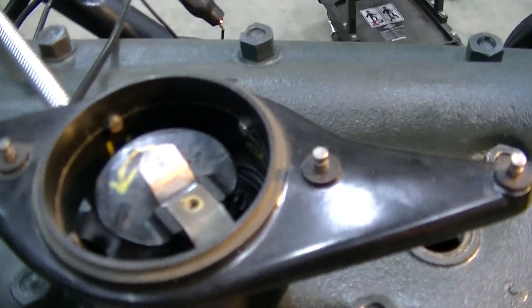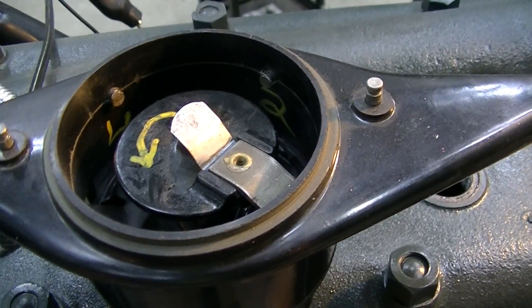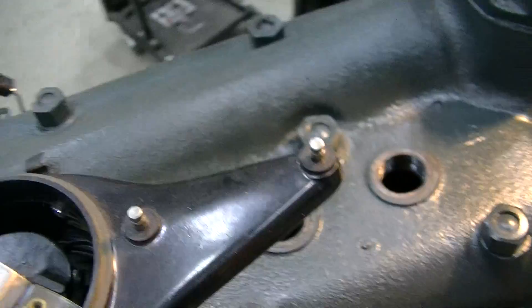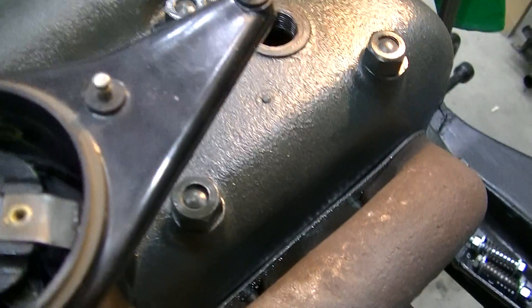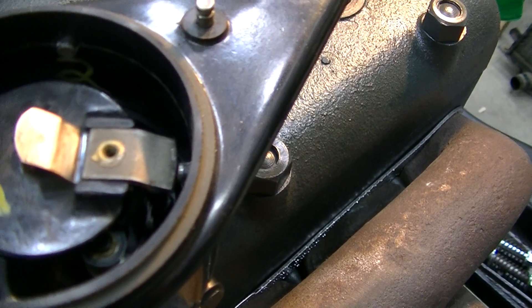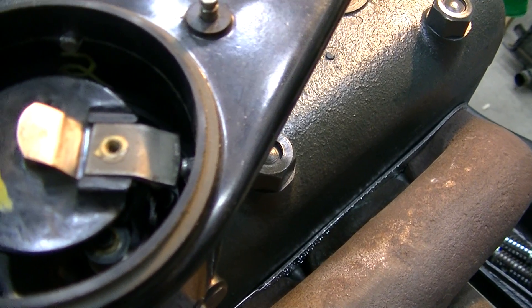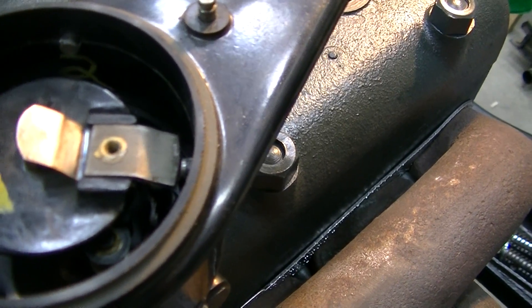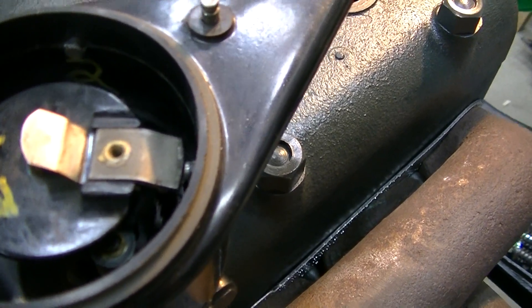For my own simplicity, I've marked the rotor in the direction that it rotates. There's a little gap between the rotor and that pin for number one cylinder — that's fairly important and it is adjustable; you can bend that tab to get that clearance so it's not rubbing but is very close, so the spark has to jump across there.